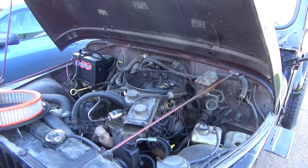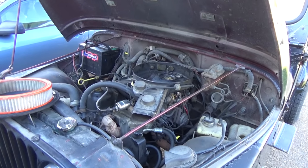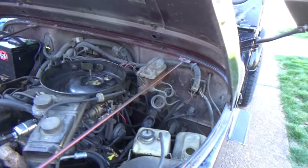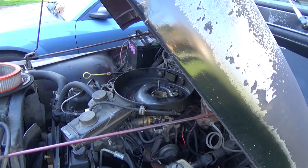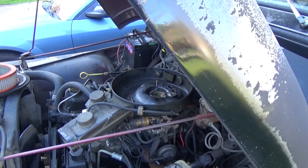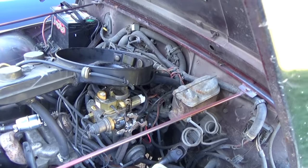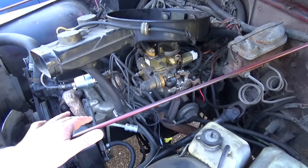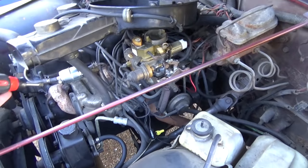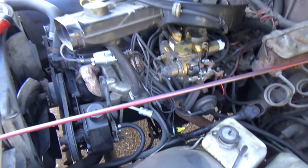It's almost like it's either the fuel line gummed up, or it could be a totally bad carburetor. If it sat for a while — if the float's stuck, if it was empty and the float's stuck, sometimes the needle can get stuck down. That is a rebuilt carburetor. I'm going to look down there and see if we get any fuel. Since I don't have a gauge, we're just going to disconnect the fuel filter, crank it over, and see if we get any fuel coming out — that'll tell us one way or the other.